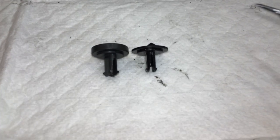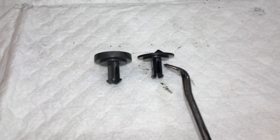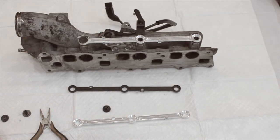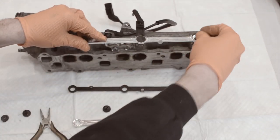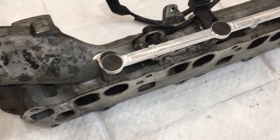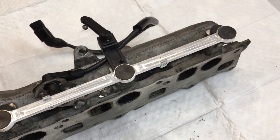The pickup point should line up with the position sensor. With the rod in place, you can install the new clips. Six new clips are included that are slightly thicker than the plastic clips, so be sure you use the new clips when installing the metal rods. Once the clips are installed, just double-check that the linkage moves smoothly back and forth. You don't need any lubrication, but you want to be sure that there's nothing blocking the ports.